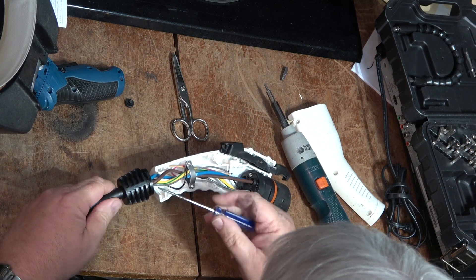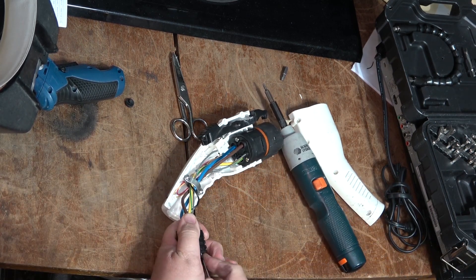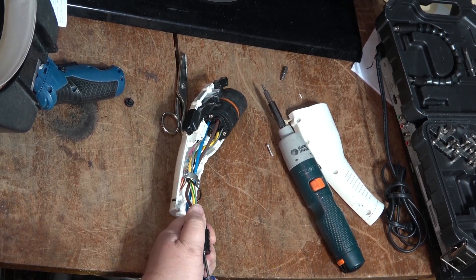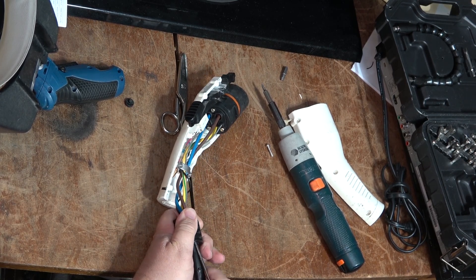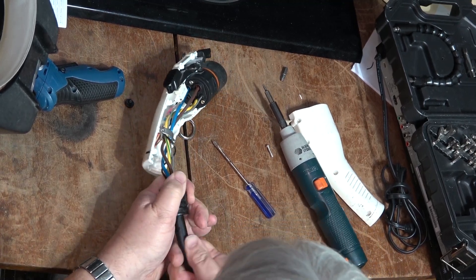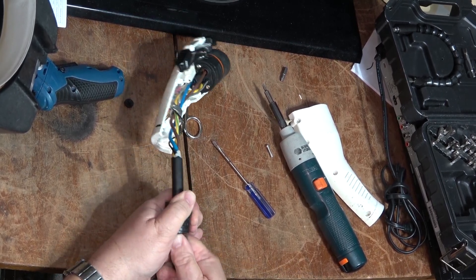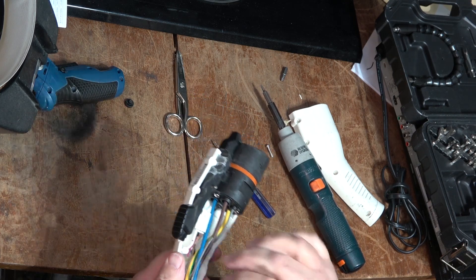When I bought this one off Facebook about six months ago, the cord would actually turn inside the strain relief, so I knew it wasn't attached properly inside. I didn't open it up before because I was sure this thing was going to be completely potted — but as you'll see it's not, which is good because that means it's easy to repair. If the cord were to break, it could be shortened and put back into the plug.